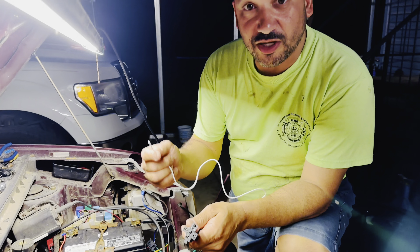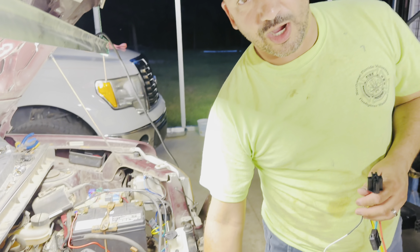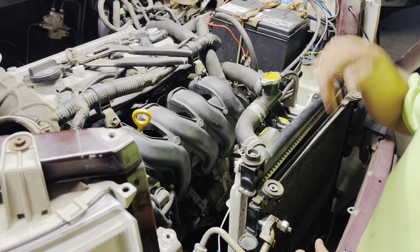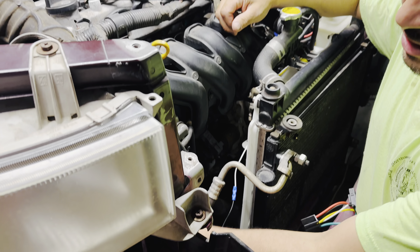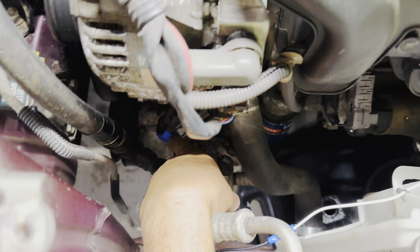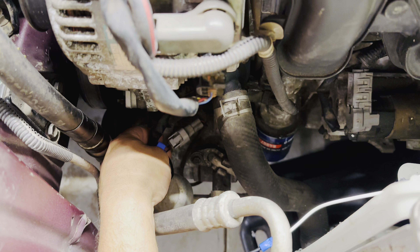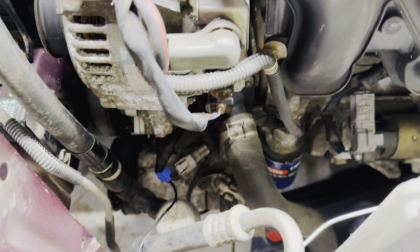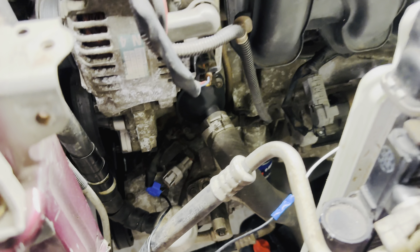On the cooling fan, you want this wire to go to your AC pump wire. So you take your test light, put the vehicle on without cranking it up, take the terminal off of the AC pump — mine is down here, and this one has two wires. I probed around and found where the test light turned on, which was hot, and I tied into it. So now whenever that AC pump gets a signal to turn on, it will turn on your radiator fan.